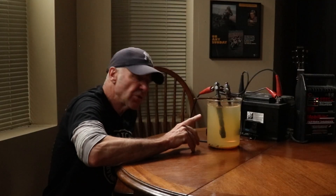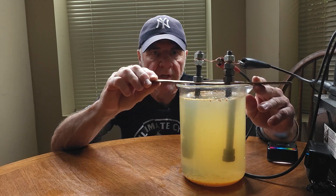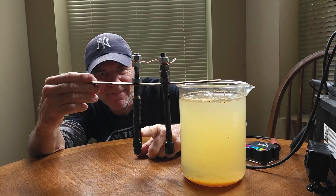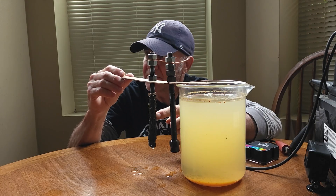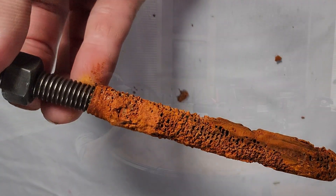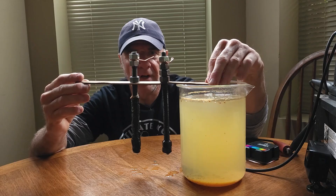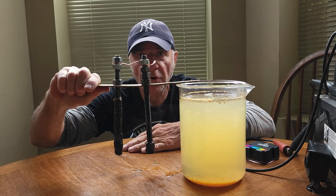It's been about two and a half hours. The process has slowed down a little bit, but you can already see a massive change. Let's disconnect it and see up close what we've got. What kind of voodoo magic is this? That is impressive — all the rust from this side has jumped across to the anode. Here's a close look at the now-rusty anode after I pulled it out and let it dry. You can actually see the rust jumping from the cathode, zipping through the fluid, and attaching itself to the anode. How crazy is that? No wonder guys like using this process. We've proven the concept in the lab, so to speak. We know it works. Let's go prove it again with the tank — real world application.